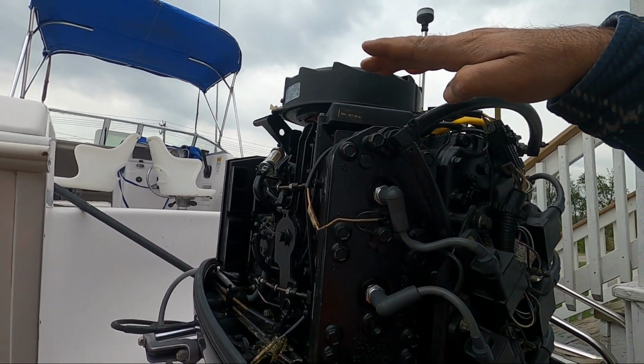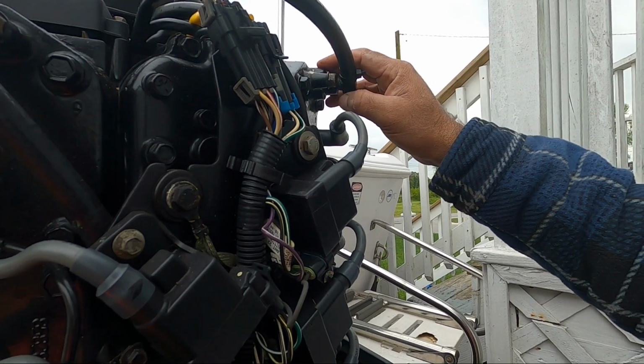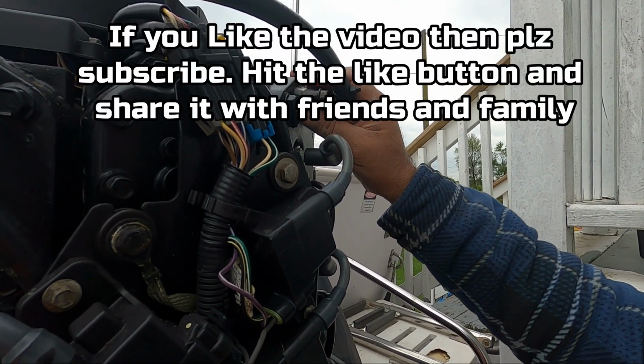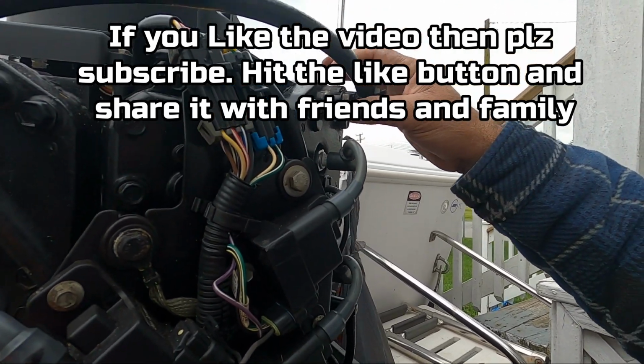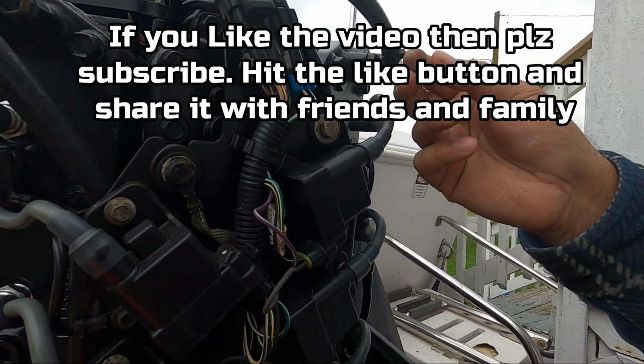So that's if you have an outboard motor and you're looking to change your thermostats, the thermostats are right here. One unit is here and the other unit is over there. This is a 150 two-stroke Mercury, so it's a V6 engine, so it has two thermostats. If you look over here, I'm seeing some kind of accumulation right here.